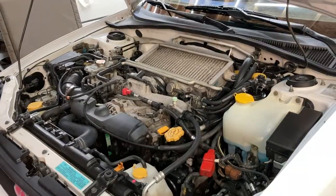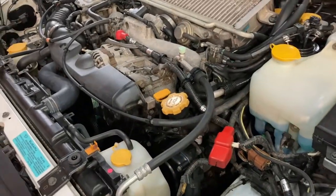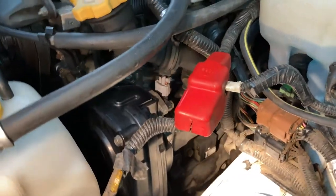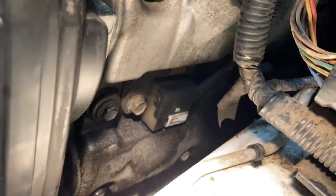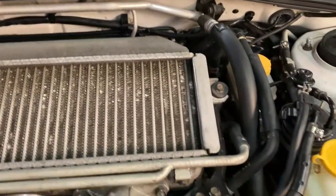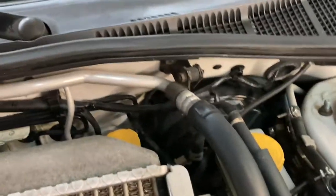I'm working on the wagon today. For those of you who don't know, this is a 2003 Subaru wagon. I'll get right into it — what I'm going to be doing is replacing the valve cover gaskets. There's one on each side, and it's pretty common with these engines that they start leaking. It's getting to the point where it's starting to drip onto the exhaust. You'll know that if it starts happening to you — you'll start seeing some of the burnt oil come up through here and through the hood scoop as well if you've got the turbo model.